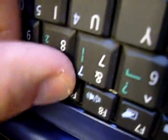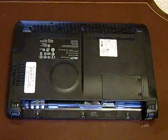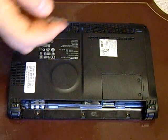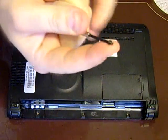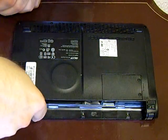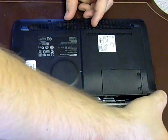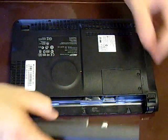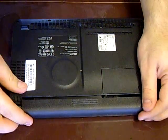Press by the Pause/Break and the F8 key to seat the keyboard. Then make sure the other keys' clips are holding. You're almost done — you only have to put in a few more screws. The smaller screws go in the back where the battery is, so make sure you use the smaller screws back there. Put the rubber feet back on, put all your screws back in, and you're ready to go.